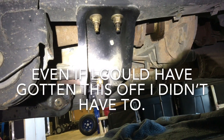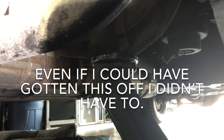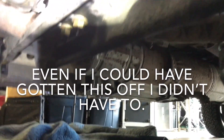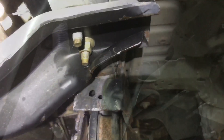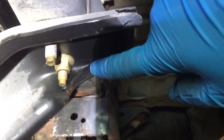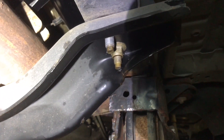We had 18-millimeter on this side and pretty sure it'll be 18 on the other side. The ones in the center look a little bit bigger so we'll see on those. I ended up putting a jack underneath the transfer case on this four-wheel drive just to give it some support. Those are 13/16ths. A problem on this truck - we bought it with a rebuild title - is that where the damage occurred, it actually bent this cross member to where I'm not going to be able to get it out, so I might have to leave that cross member on there.